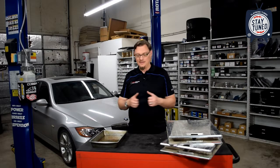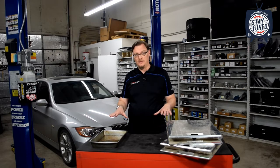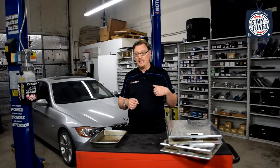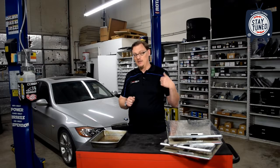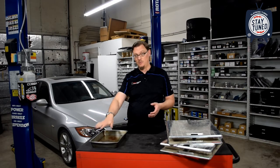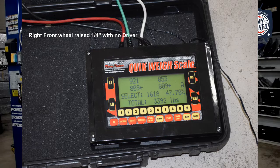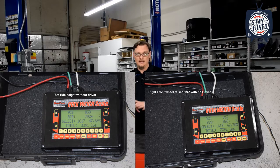Here you can see the weight of the car at the ride height we set, and it's actually reasonably close to a 50/50 weight distribution on the cross weights. Then I hopped in the car so you can see how, with my weight on the driver's seat, that weight is distributed through the four tires. To get another visual of what happens as you change ride height, we raised the right front a quarter of an inch — just one quarter of an inch on that one corner — put it back down on the scales, and you can see that small change did make a difference to the weight distribution. Then I hopped back in the driver's seat, and again you can see that small change up front affected how the driver's weight is distributed.